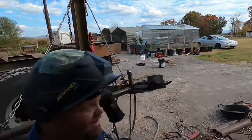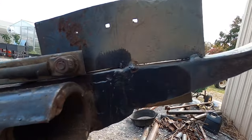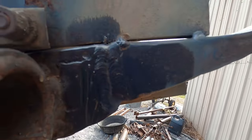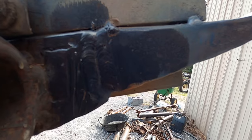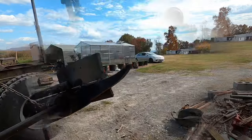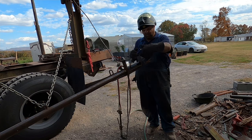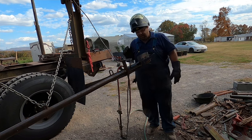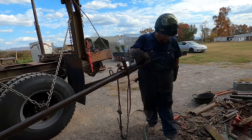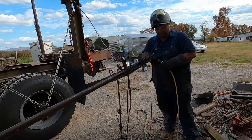All right, I'll bring y'all back over here and let y'all see it again. So now we've got our two stringers in — not too bad. I got a little undercut right there at the bottom I've got to fill in. But we're going to go ahead and clean this side up and then move the channel around. Now I'm going to get my tacks off this side and get this angle channel moved over here. That should keep us straight when we start this big weld on this side — at least I'm hoping anyway. And if not, it'll be good enough for who it's for.